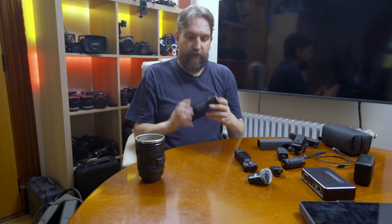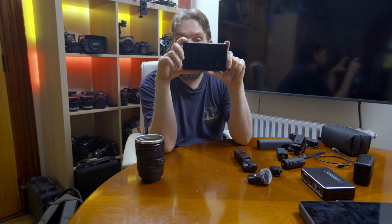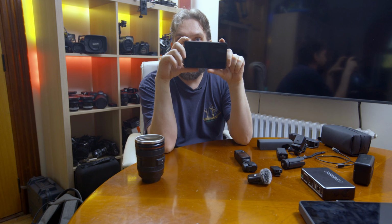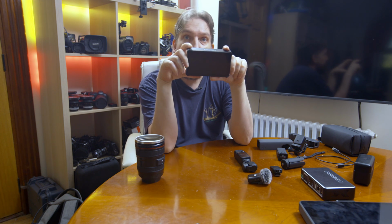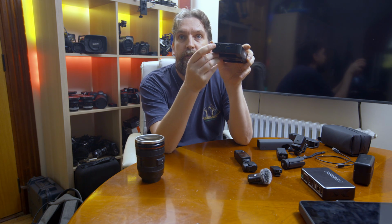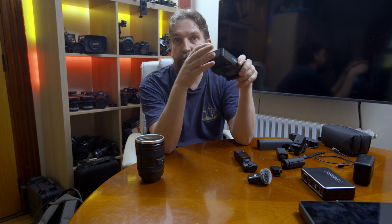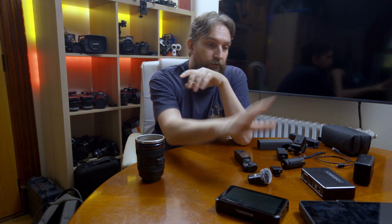And something new that I also have to make a video on yet is the Magewell Director Mini. The USB inputs of these will also take the DJI Pocket 3. You won't get audio, but that's not a big deal because you can inject audio on the side of it. I haven't been able to get audio to work with the DJI Pocket 3. So these three encoders plus Belabox will work as encoders for the DJI Osmo Pocket 3 in webcam mode.